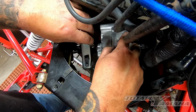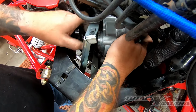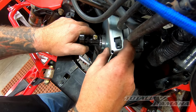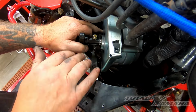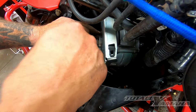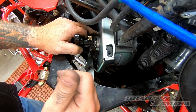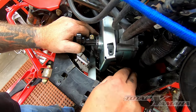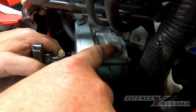So what we do next, and I know it's a little bit of a cumbersome task here because there's a lot of stuff in the way, we have to get this bracket mounted on here with all 4 screws, and then you pull out the bottom screws once the tops are tight, because that also gets bolted to the bottom bracket, which we have to do kind of from underneath. But you want to make sure it's in the right orientation. So head down, and you can see the pin for power is up.